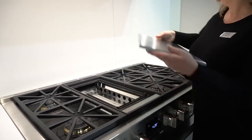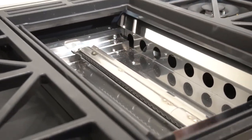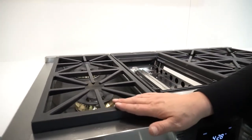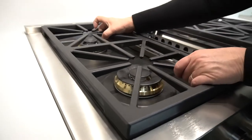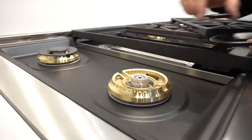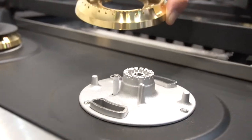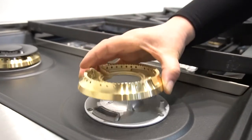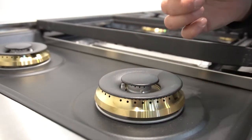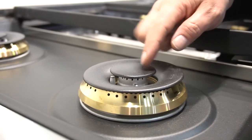Will not discolor. Retained heat. Tube burner. Each of our burners on the stove are 18,000 BTUs with one 20,000 BTU power burner. Dual stack brass burner ring. Brass for long life, non-corrosive. Five settings on the burners. It's a crescendo burner — piano — the flame rolls underneath the burner cap.